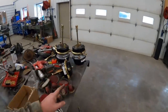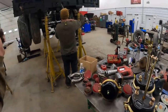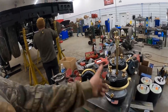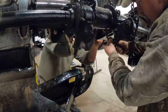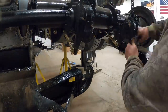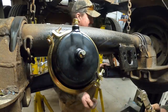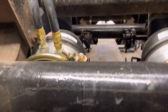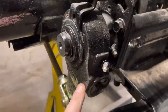It's a little different situation on these since they have a spring brake - they're actually applied right now because there's a spring in there. What we'll have to do is shoot air into the front of the trailer, and that air is going to fill the emergency side of this chamber and release this rod. Then you can adjust the brakes. When you unhook the air, that brake is going to come back on. But these, without the spring brake in them, you can adjust with no air in them. We got the middle brake chambers in - the spring brake chambers. We'll wait until we get air on or get outside to actually adjust these.